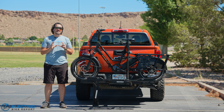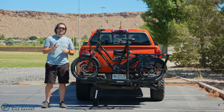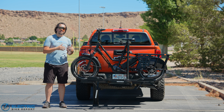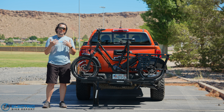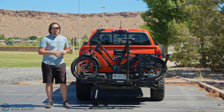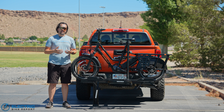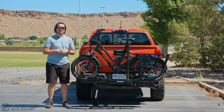Let's talk about the essential things you need to know for fitting this to your vehicle. Yakima sells the OnRamp LX in two different sizes — for either a two-inch or a one-and-a-quarter-inch hitch. The one-and-a-quarter-inch does drop the weight rating slightly, from 80 pounds per tray or 160 pounds total, down to 70 per tray or 140 total. Yakima also gave this an off-road rating, which drops it more significantly to 48 and 42 pounds per tray respectively, but if you have a lighter mountain bike you could technically do a little off-roading with it.